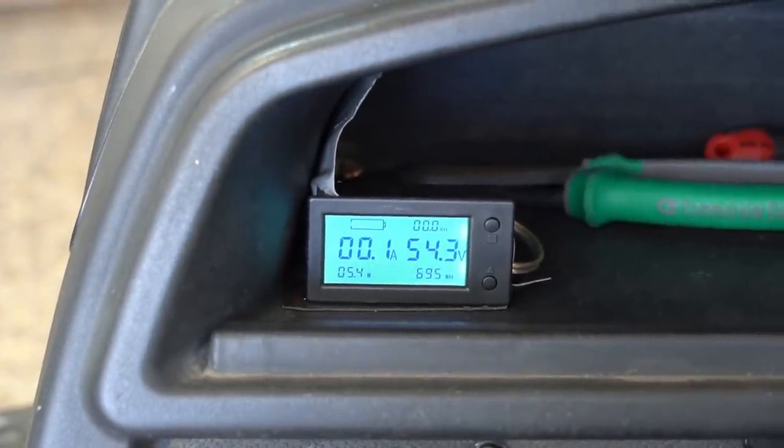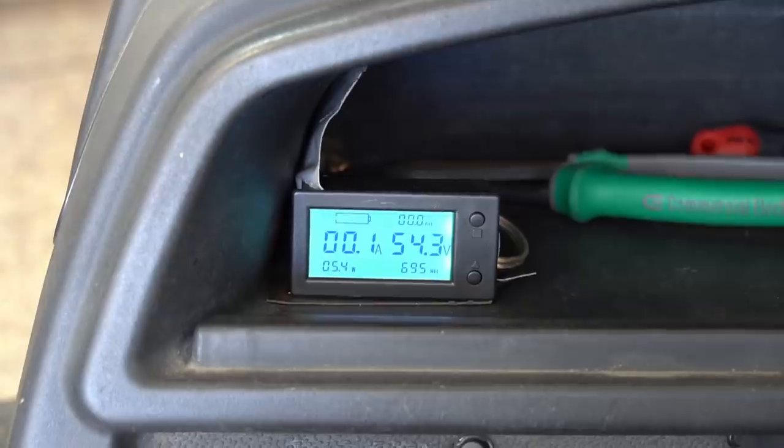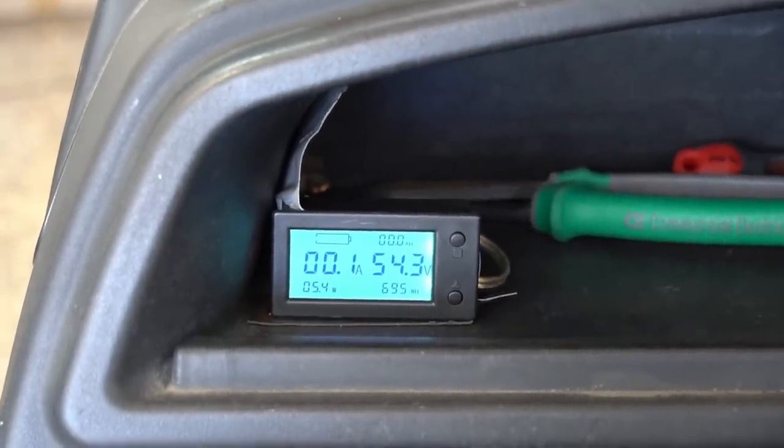This is an AC motor, so we're actually charging the battery while going down this hill right now. I've been driving for about 30 minutes and it's very hard to run down this battery — it's really efficient. I think I could probably get around 25 miles out of this thing, even going up and down hills trying to drain it quickly. The voltage is not dropping much; with this chemistry the discharge curve is pretty linear so it's predictable. After that long drive I only used 695 watt hours, so this thing can go really far.